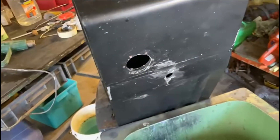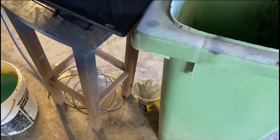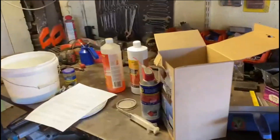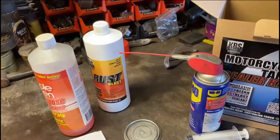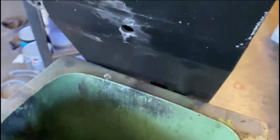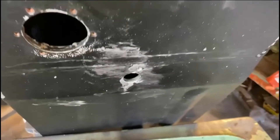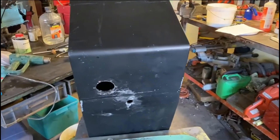So it's a success. Would I recommend it? Yes. Is it cheaper than buying a new tank? Probably yes. You'll probably need a day - definitely get a heat gun to heat the tank up to dry everything, and blow the water out with air. Be methodical, don't rush it. This kit costs about $70 Australian, which is not a lot really. For a large tank of 45 to 50 litres it did it comfortably with no problem at all. There's a bit left over - I didn't skimp. The top, bottom and sides are all done. We'll pack this away, put the pickup and sender on, and the tank is done.